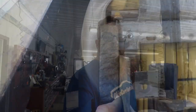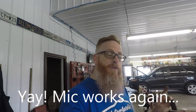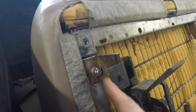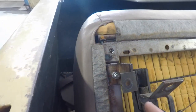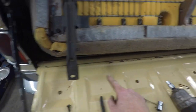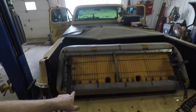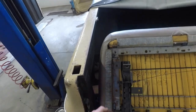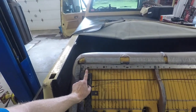So basically we should be able to mount it like this. We've got our brackets cut and holes drilled, but we've come across our first little snafu — though we've come up with a quick solution. Initially, the bracket was meant to be spun 180 degrees to weld along the edge, but that didn't line up the holes. It was pulling things too close together. I took a quick measurement of the rear mounting holes in the floor — it's 47 inches on center. If I mount the bracket this way and weld along the edge, we'll have 47 inches in both places and we'll be fine.